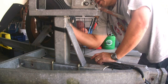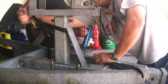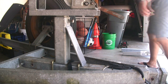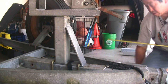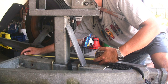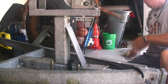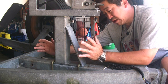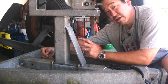The other thing I'm going to do right now is disconnect the boat from the winch. I'm assuming there might be a little bit of tension on there, and I don't want the winch stand to move too much when I take it off. I also need to make sure I put the winch stand back in the same spot, so I'm going to get my tape measure and mark it off. The back edge of the winch stand is 12 inches from the back edge of this crossmember — that way I'll have the boat balanced in the same spot. Now once I finish removing the U-bolts, I should be able to lift the stand off, and then the next step would be to take the back bolt off and slide the tongue out.